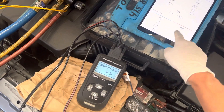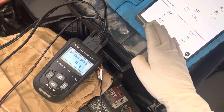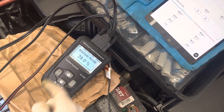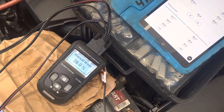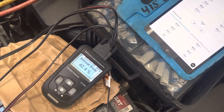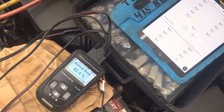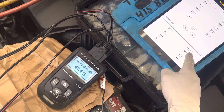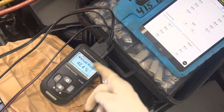So now I'm going to manually override that. Watch the pressures — can you guys see the pressures? I'm going to try to focus in a little bit so you can see both, and you're going to see my finger go up on percentage. There we go — 29 percent. Barely anything is happening. That's not enough to do anything under the load it's under. Let's feed it a little more. You're seeing something happening right there — the high side is going down, the low side is going down, the high side is going up. My eyes are bouncing all over the place.